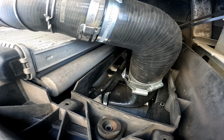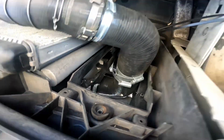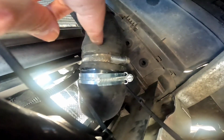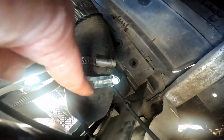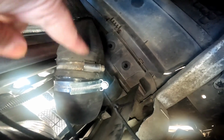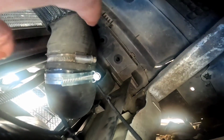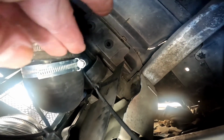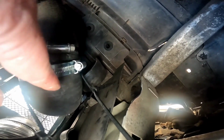Now your bottom hose is slightly different. So we're going to use a coupler on the bottom of the hose here. We're then going to cut the 90 bend as far up as we can. As you can see, this 90 bend will normally be like here. We've cut it right to the corner because of the overhang here. It will end up hitting here. So you want to cut this right off here, so literally on the edge of the 90 bend, and use the 90 bend to go inside there.